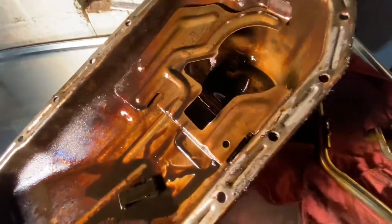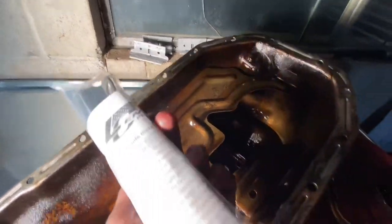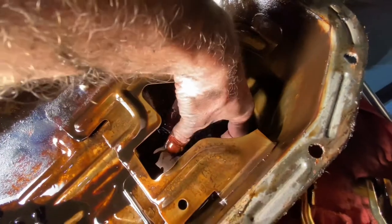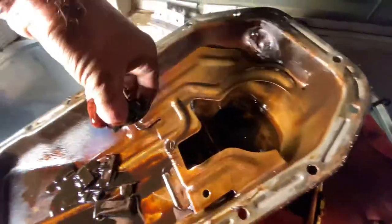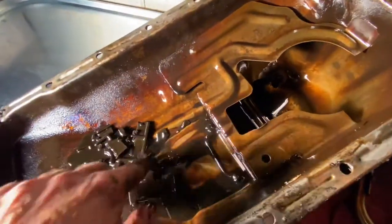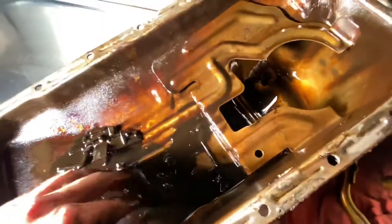We just got the one big chunk here. Our replacements are from LC Engineering - metal-backed guides so they can't separate. They have a nylon liner on them so they should be a lot more sturdy and long lasting. Let's see what's in here... holy shit, I can't believe it - all plastic guides. Why the hell would they sell all plastic guides? Unbelievable. Well, good news - we were only diving in here to stop the leaks and the coolant leak off the back side of this plate, but it's a damn good thing we're in here.